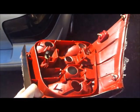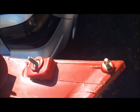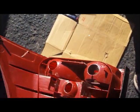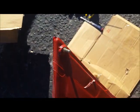I'm going to try and sell this single Hella and maybe that'll help someone who backed into a column on their passenger side. When installing these, it's important to note that on the passenger side you've got three bolts and a press-on nipple, while on the driver's side you've got just three bolts — no press-on nipple.